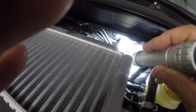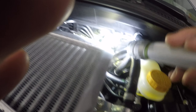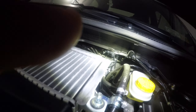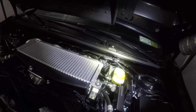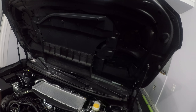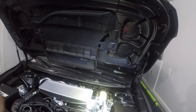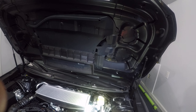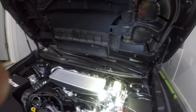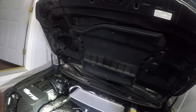For the OBD2 wire, I found this grommet right here pops out very easily — you just go in there with a long screwdriver and pop it out from the inside. Then you make a little slit in it with a razor blade right down the middle in the area that has the empty hole. The other two holes have brake lines going through them. You make a little slit, put the wire in, pop it right back in, and it's nice and neat through the firewall. Pretty easy.